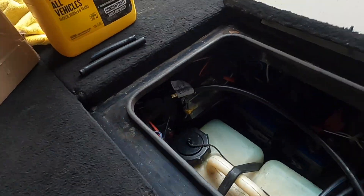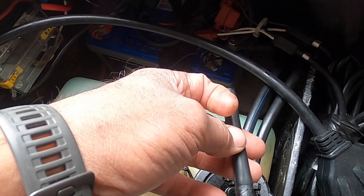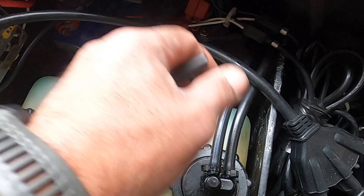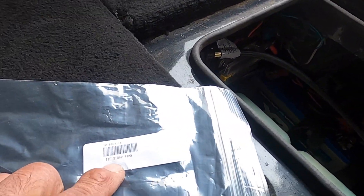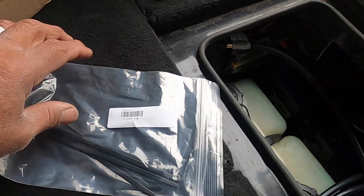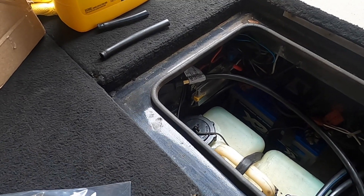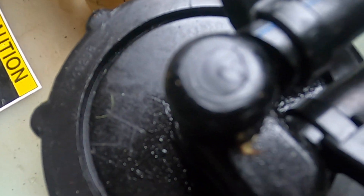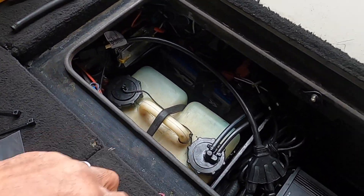I'll put a picture or video in there so you can see how that was restricting the flow. Here's what I did to correct it. You're going to cut this line right here, and you'll have a little hose left over like this. You want the line as straight as possible when you come back. Then you're going to need these zip ties — here's the part number. Not regular zip ties from a box store; these zip ties have a curl on the end. See how that wraps around there? Otherwise it's going to be pinching the hose.